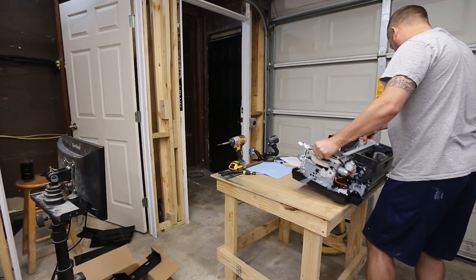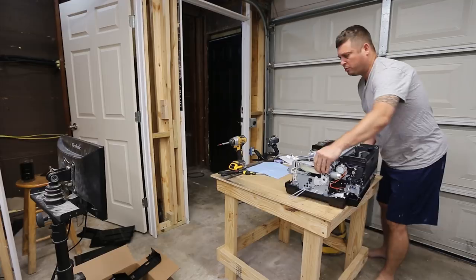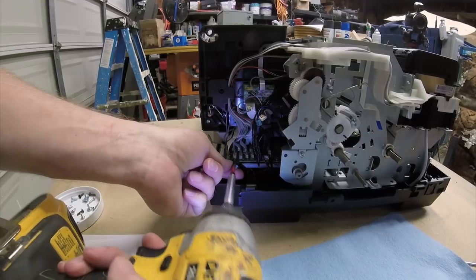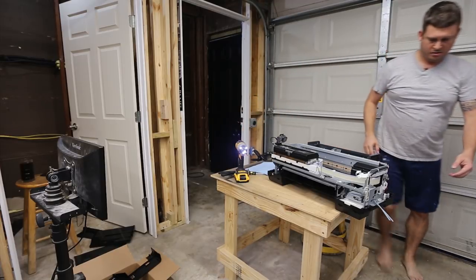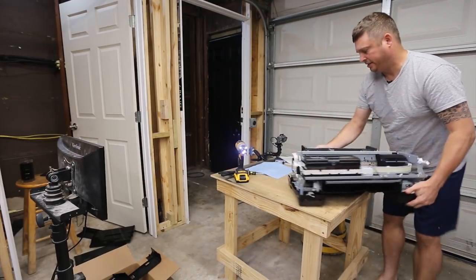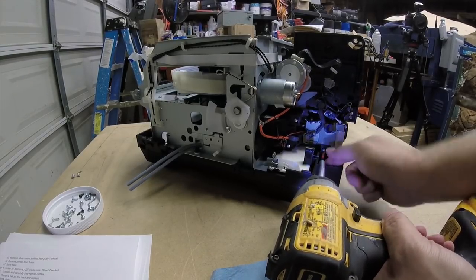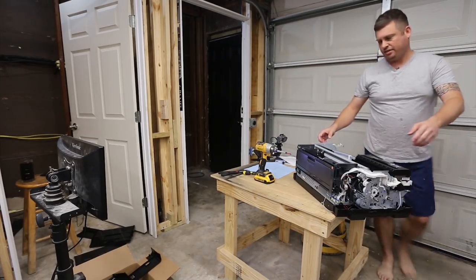I'm looking for a safe place to pick it up. There's one more screw hiding down in here, underneath where the Wi-Fi module was — right there. It was on the list, I just missed it because I thought it was covered by something else. There's another one on the other side in the same spot. Just work gently — trial and error if you don't rip on things. I think that should free us from the base.